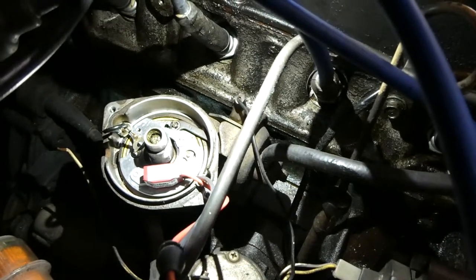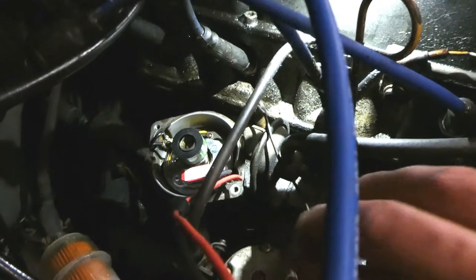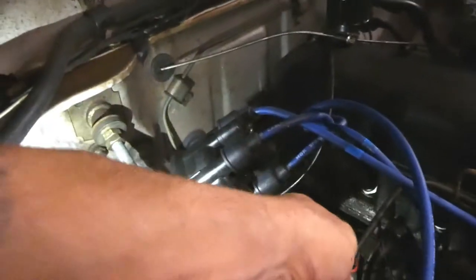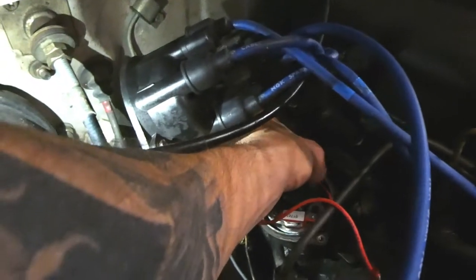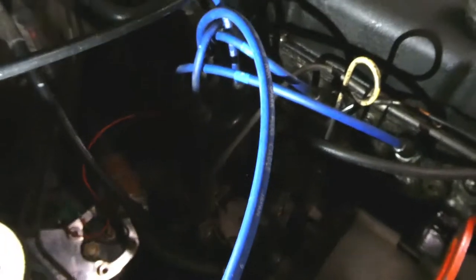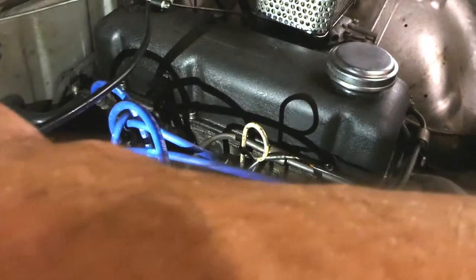Let's connect the earth wire, put the magnet on, rotor on, and close it up. I've got the earth on. Now to get this piece on — make sure there's no hairs on it. There we go, all the way down, rotor on. Run this around the edge, slide it in there and slot it through so it's running around. Get this on top and screw it down. The distributor cap's tightened on, the rotor's in. Just make sure all the spark plug leads connecting to the engine are in order and still tight.